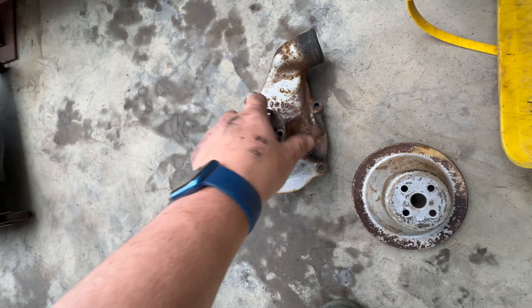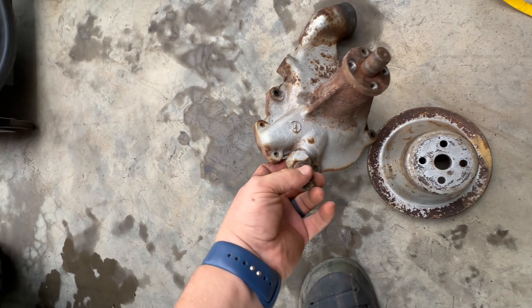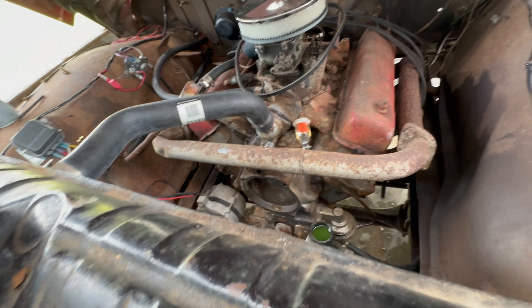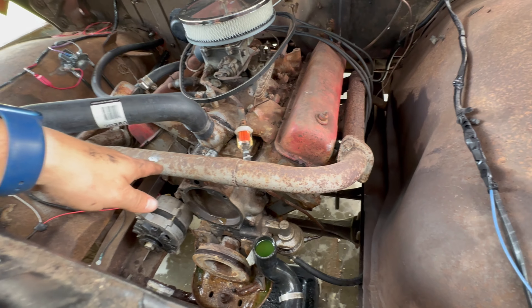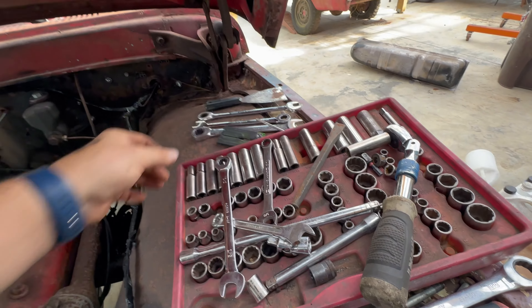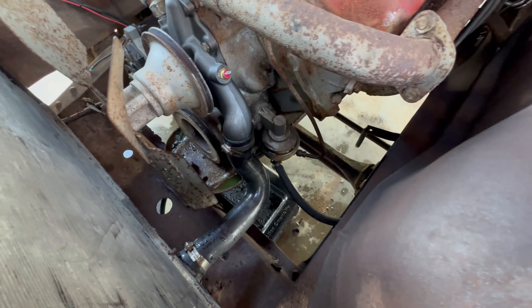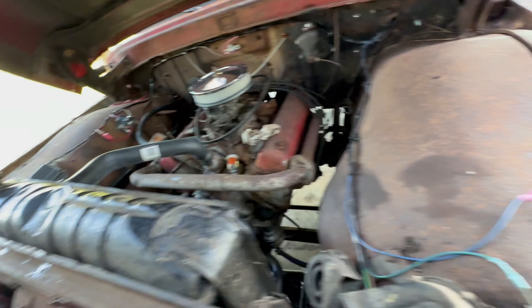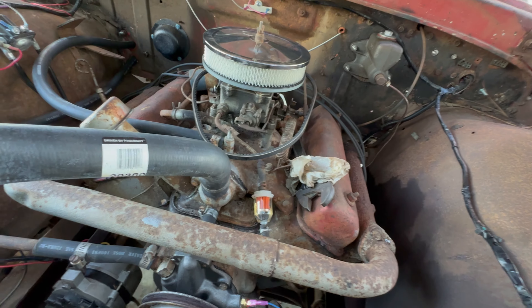I finally got that old water pump off there and the old gasket scraped off. I had to beat the stud off the pulley. Now I gotta get that stud off while I let a little bit of this gasket maker set up — I'm gonna do a thin coat, stick the gasket on, and do another thin coat. We don't want this thing to ever leak. I had to throw the scraper aside and break out the razor blade because that old gasket was really on there. All right, the new water pump is on, everything's hooked back up — just need the belt back on and to top it off with water or antifreeze.